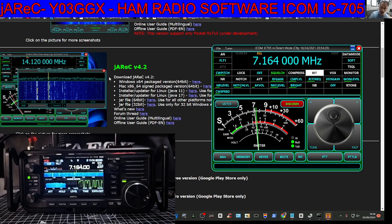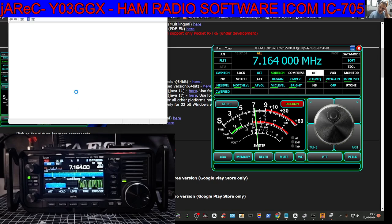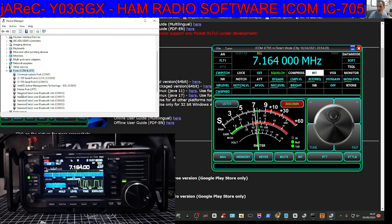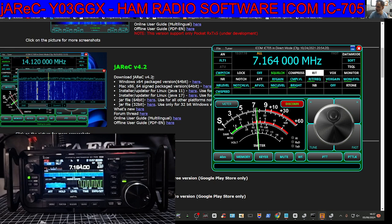All I needed was one cable going into the USB port on the right-hand side and into my PC. If I right-click, then Device Manager, Windows squares, Device Manager, and then select Ports — you can see it's the top one, which is COM10. Make sure you've installed your ICOM drivers and you'll be fine.